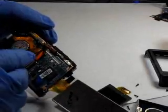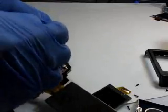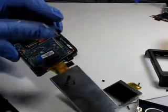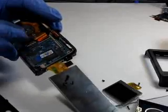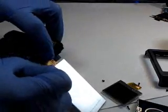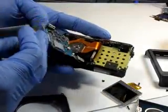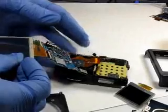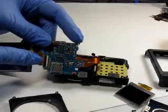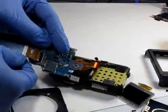The next step is to remove the screw here. Then we're going to go ahead and remove the LCD. In order to do that, we need to flip over this board — and in order to do that we need to release the claw here, so we're going to release the claw and pull up on the board. Now we can flip the entire board over, and you can see here's the ZIF cable clamp for the LCD — we're going to flip that up and remove the LCD.